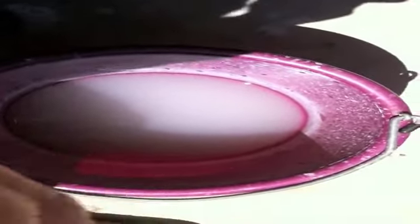Okay, here we go. All your water's turned white from the sanded plastic, rinsing off the sanded plastic. So I'm going to remove the old sanding disc, the 1000 sanding disc. And now we're going to attach the P3000 sanding disc to our sanding block. Moisten it down with water. And now we're going to begin to sand with the 3000 grit in a vertical direction, or up and down.